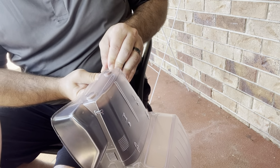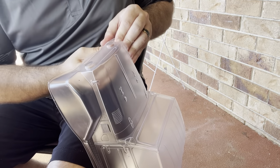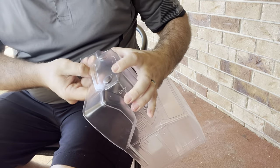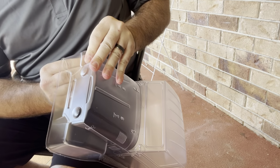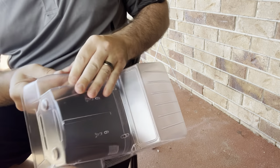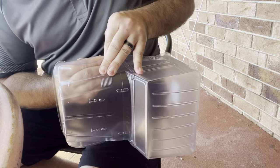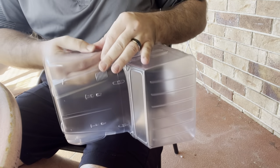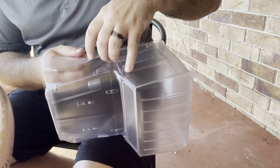So you're not trying to do this in one go either. Don't just keep bending it the first time. You want to bend it, and then off. There you go, look at that. So it sounds rough, but you may find, because this body is quite thick polycarb here, as you can see, how much pressure I'm having to use to break through it. But you can see by supporting the body, the stress is going into here, not into here.